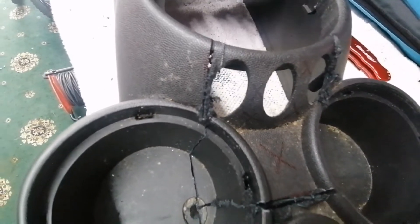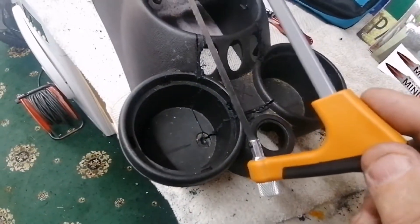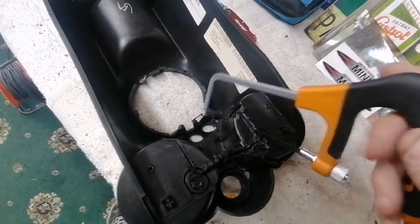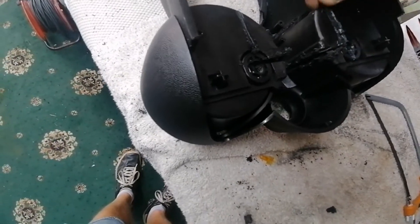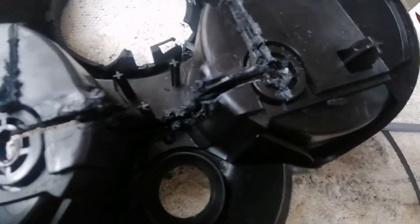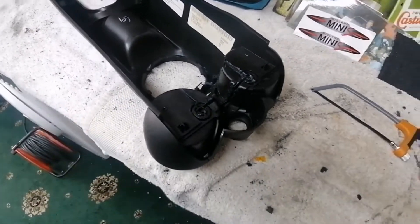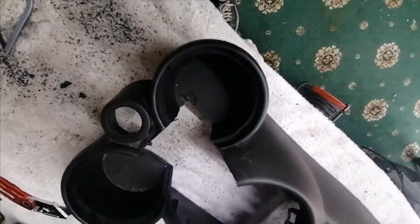I've cut down the inside of the cup and up around the old DTC button. I ended up getting a junior hacksaw down there from this side, joining up the centre of the hole all the way down. There's debris on the side of the cut from the Dremel where I got as far as I could and stopped, but that just breaks off quite easily and the edge is quite clean. I'm going to do the other side now the same way.